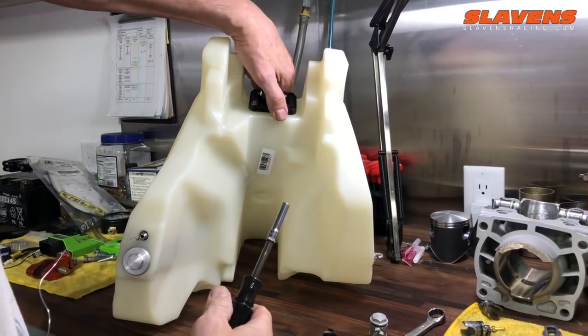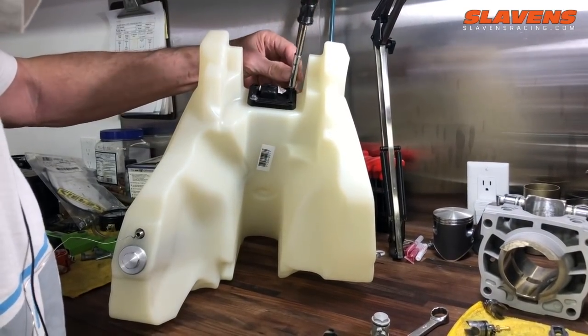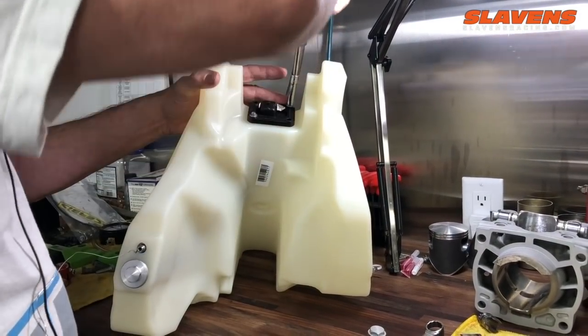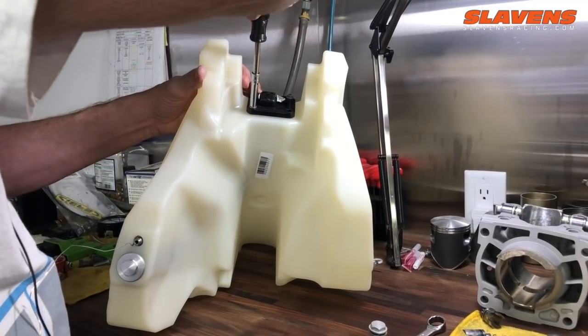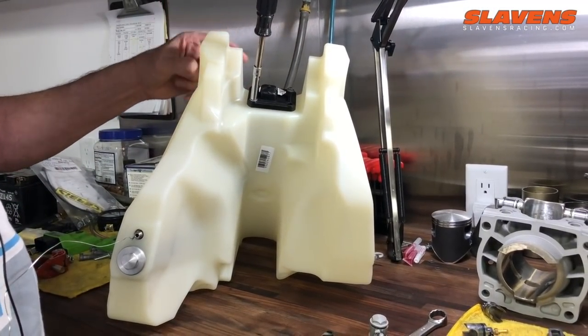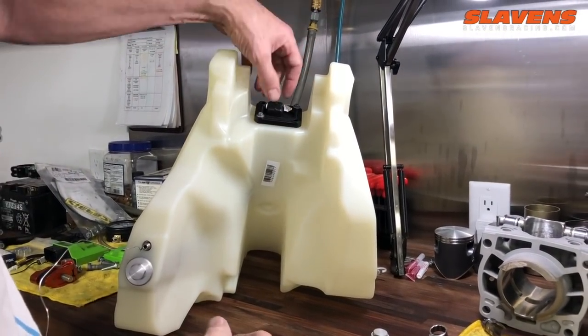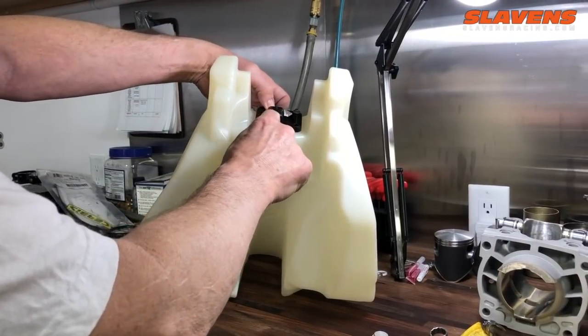Absolutely do not use a torque wrench, and don't use any type of a big ratchet or anything. Just use something like this. Even a small T-hand will be fine, but you just barely snug them. I can do this with 2 fingers. Oops. Well, almost. Anyhow, you just barely snug. You put all 4 in, and then kind of go around and just snug them just slightly more.